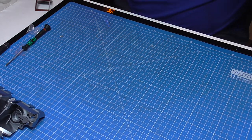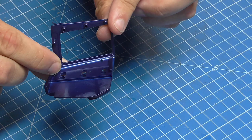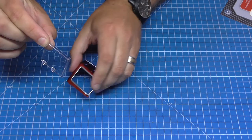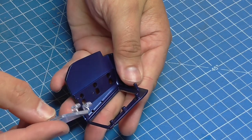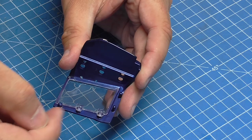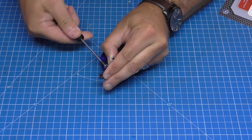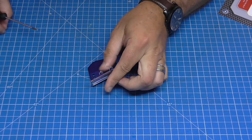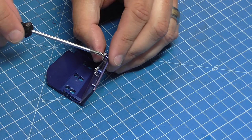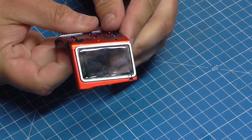Check out this window piece with all the flame details on the front. We have some acrylic glass to go in — line it up with the shape of the window so it sits over the edges, ready for AM screws. Remember, you're going into metal so use a bit of oil, but don't over-tighten or you'll crack the plastic — just hand tight. The glazing is now in.